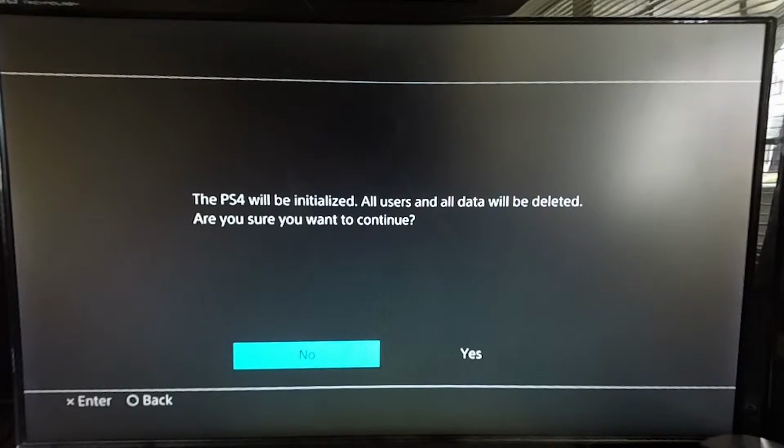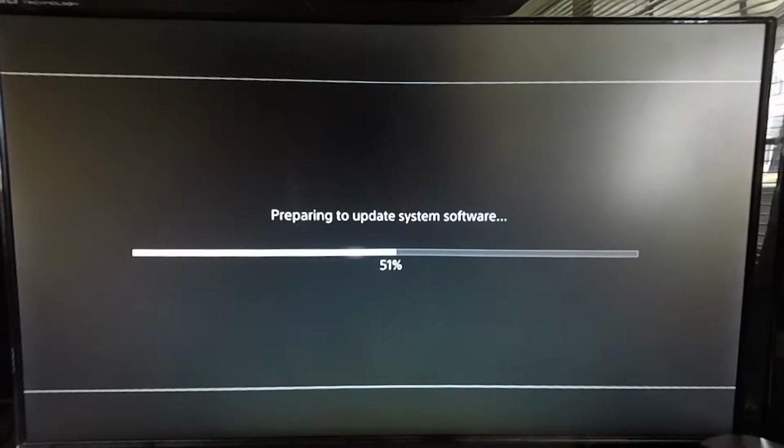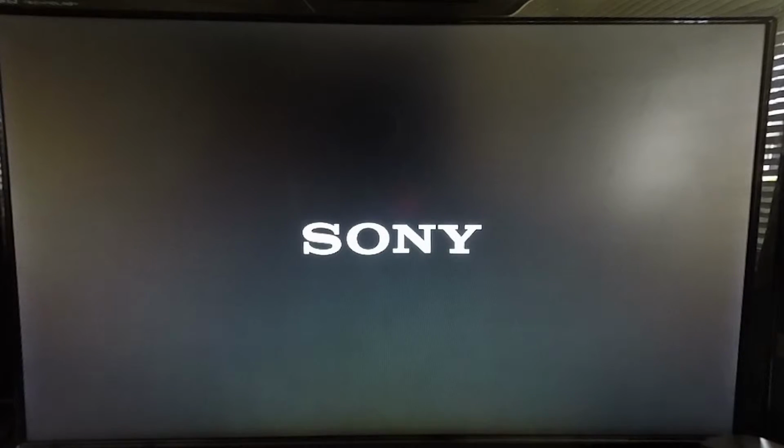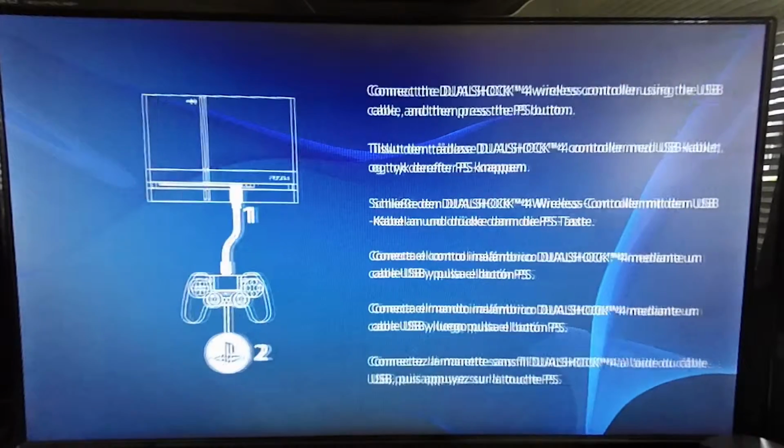I would like to apologize for the quality of the video for the next minute or so. The HDCP re-enables by default, which makes it impossible to capture anything from the console, and I didn't want to screw it up while I was doing this, so this is all done with the GoPro. Sorry about that. You're going to go through a bunch of install screens, and it took me about 10 minutes to get through these. But once you're through those, you're going to set up the console as if it was brand new, because technically it kind of is, right? It thinks that it's a new console because we got a new hard drive in place.